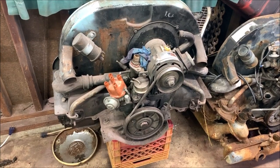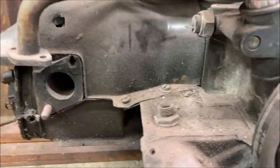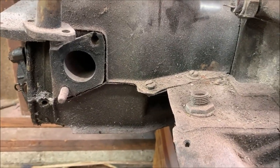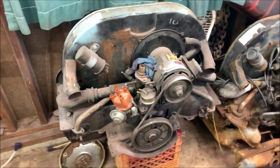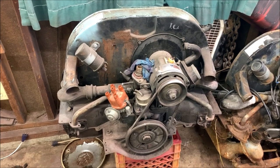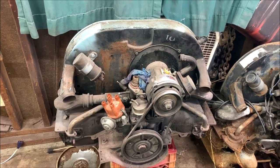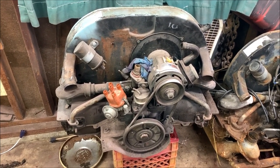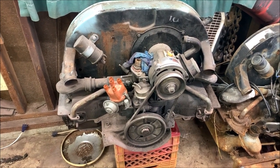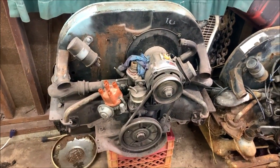This is a good running engine — there's absolutely nothing wrong with it except the prior owner snapped off a stud in the head for the exhaust, and there's no way of repairing it. I'm going to do a compression test on that motor probably in the next video, and I expect it to be fine. I'll still strip it down to the block, put new seals, new gaskets, everything new, freshen it up, paint all the tins, make it pretty, and then take heads from a different engine and put them on.